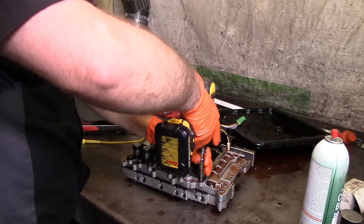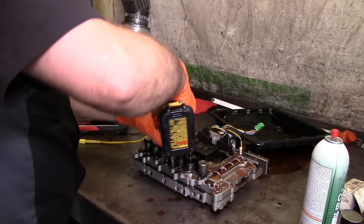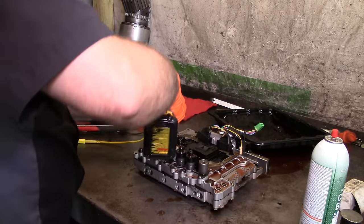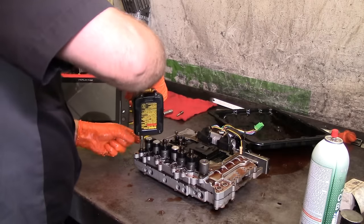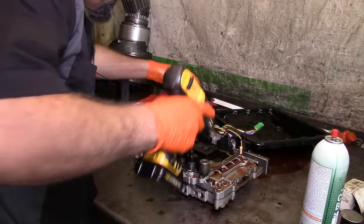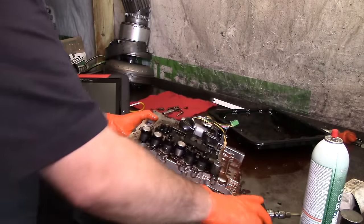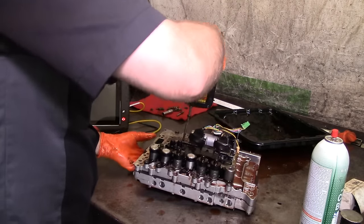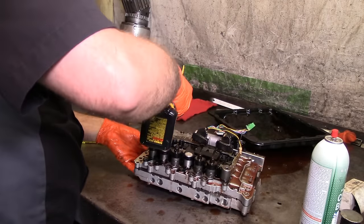All right. Then we're going to do a very simple test to see if the pin is broken. We're going to do a continuity test. I'm just going to hold the nut on the opposite end so we can get this bolt off. Do it on this other one. We got three of them.